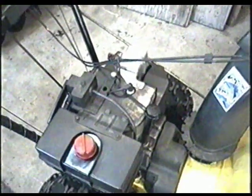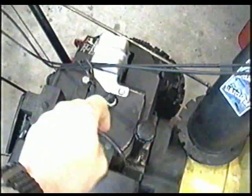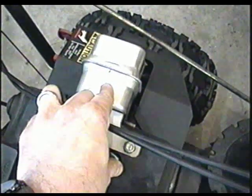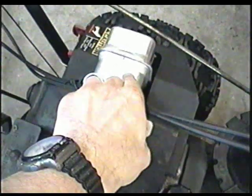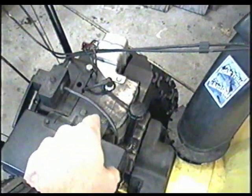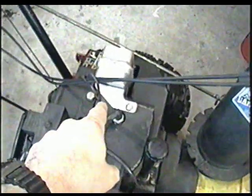The compression on this engine feels pretty good this way. Now if you notice your engine is burning oil and has low compression, you may want to replace or at least check the rings. Also, if you notice your muffler gets red hot — literally red — you'll especially see this when you snowblow at night. That means it's losing compression through the exhaust valve, causing a lot of heat to go to the muffler. Sometimes if your carburetor is not adjusted right, like too rich, it will cause that too, but I rarely see that. Usually it's because the valve is leaking.